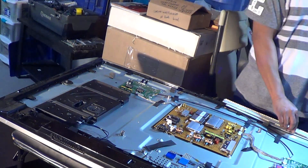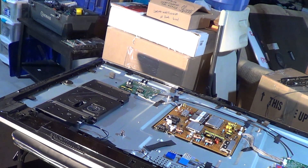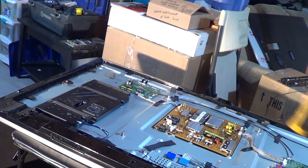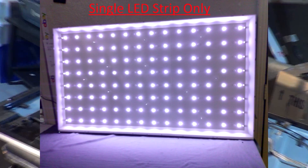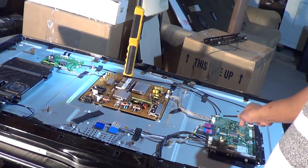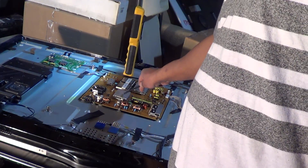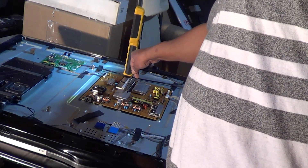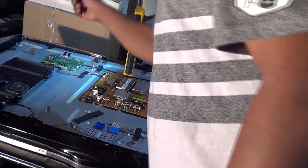The way that you check these is they don't have the regular connections to the power supply like you would normally see on a backlit TV. This one here uses a separate driver board, and that's what the plug looks like. So we have our main board here and the T-Con board down here on the bottom. This is our power supply board. In most cases the power supply will have the connectors for the LEDs — for the backlights — but this one uses a separate driver board. From the power supply to this plug here is the driver board for the LEDs.